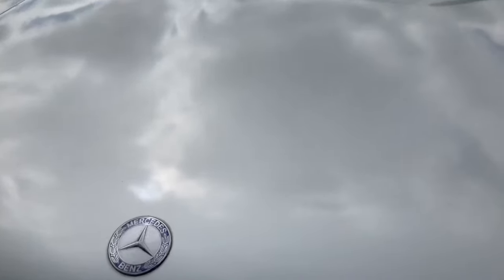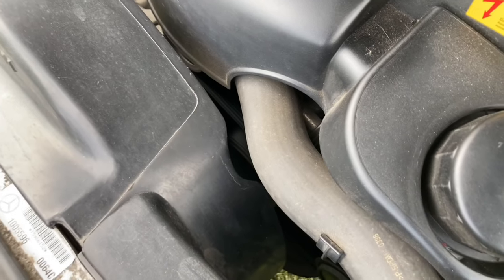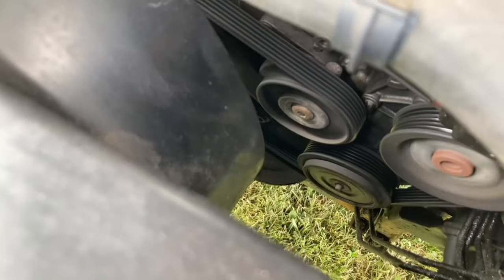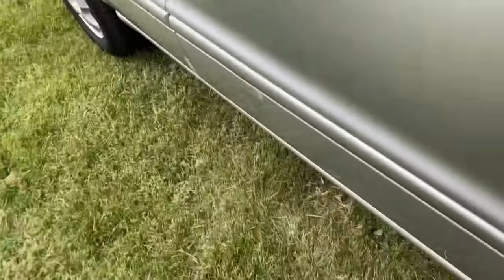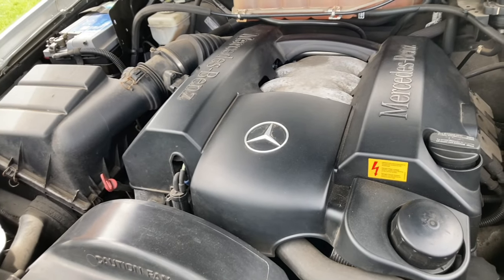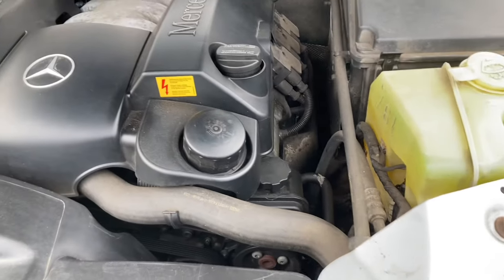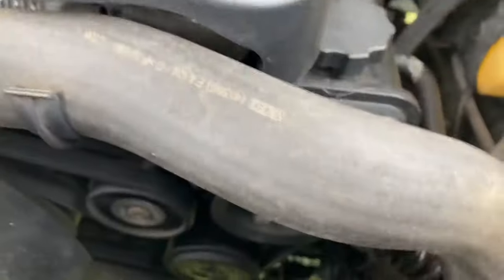The other issue — this is a bit of advice for people on the ML Owners Club. As you can hear, there's a whining noise. I've been wondering about it. I've worked on this car for years and about six months ago I did notice a little bit of a whine on the engine, very minor, and I put it down to possibly the power steering pump. But it's got worse over the last few months. I've done a bit of investigation using a stethoscope and there was definitely no noise coming from the pump.